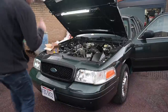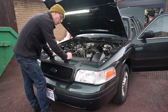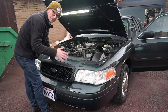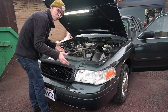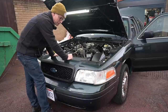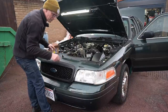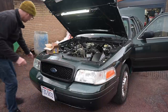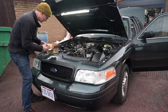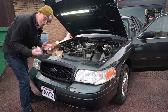Here at the front things are a little bit easier. I've had a chat with my MOT man and done some research. For a newer car - 2011 or 10 years or younger - it would have to go through an IVA, meaning everything would have to be as if sold new in the UK. Because it's an older import pushing 20 years, I can leave the lamps functioning as they currently do, but they do have to work properly. I've got a headlamp out, a running light out on the side, and this headlight is wonky because the little metal retaining strips holding it in place are missing one.